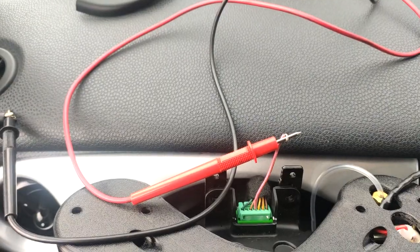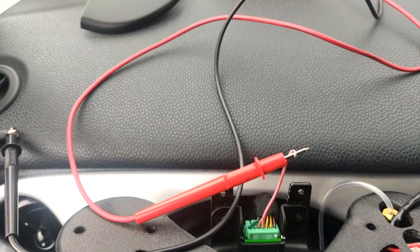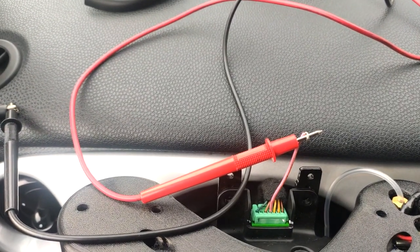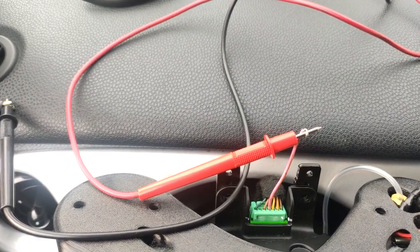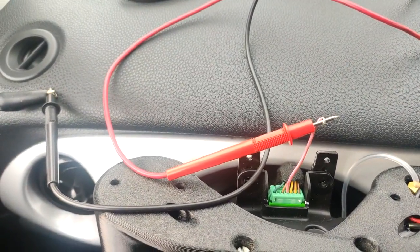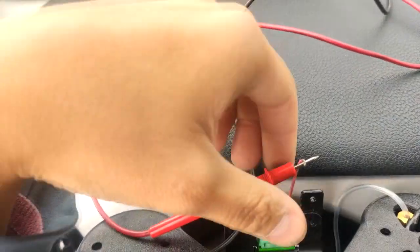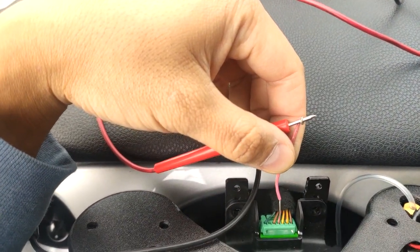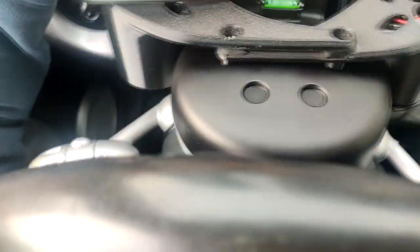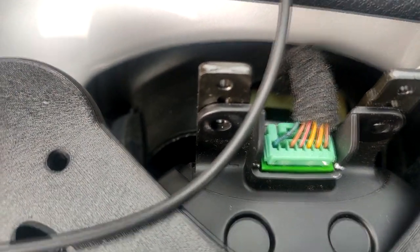I figured it out by reading a PDF file from Alta, who manufactures aftermarket parts and pulleys — I'm running their 17% pulley on this car for the R53. They also make parts for R56s. They have a PDF detailing installation of their gauge set with a section on wiring for illumination, but they did not specify exactly what wire the gray wire was. They said to connect the gray wire, which is the only gray wire on this connector that connects to your tachometer — it's exactly pin number 4.